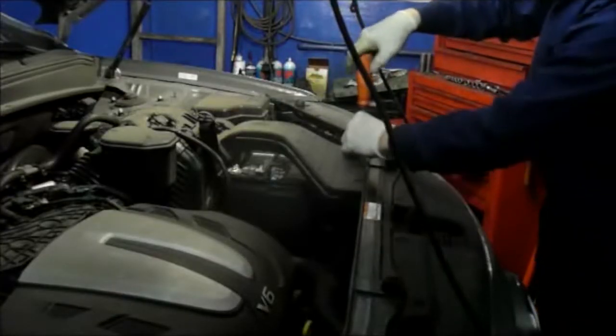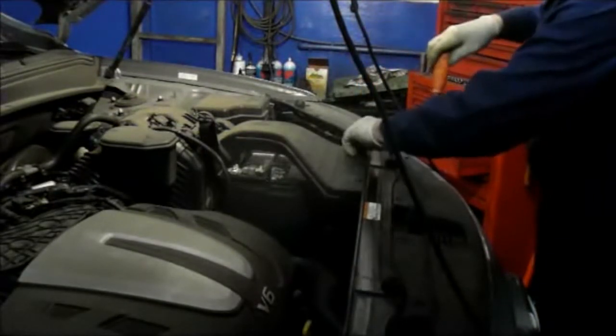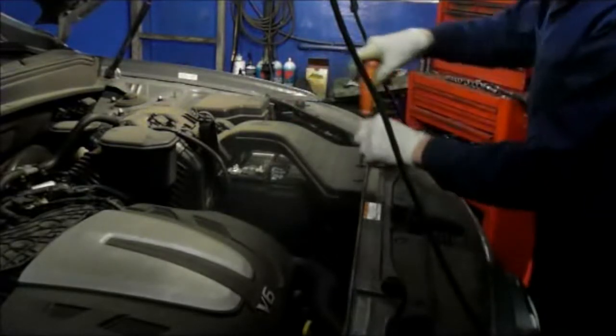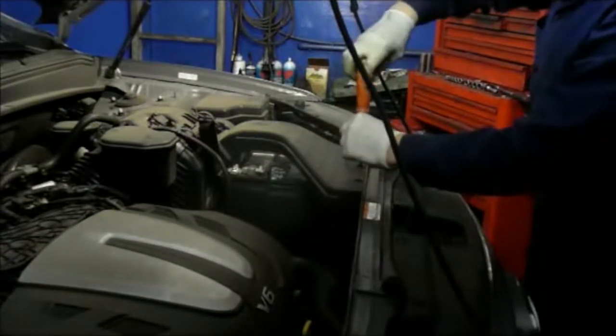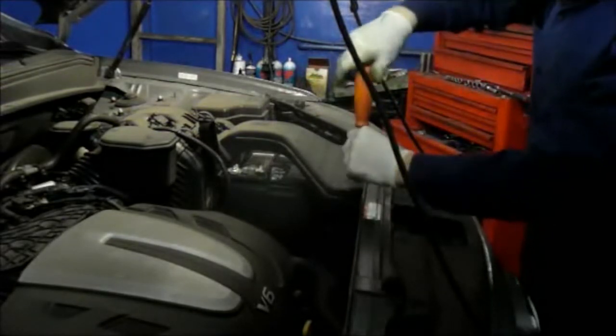First thing to gain access, I'm going to remove this cover right here — just take these three screws out and start to remove the fan assembly. You unscrew and pull up each screw, then pull that plastic piece out from down below. I want to remind you: your battery is disconnected, so you don't have any issues. Screw the screws all the way out and pull that plastic piece right out — you'll need to reuse these, so don't lose them.